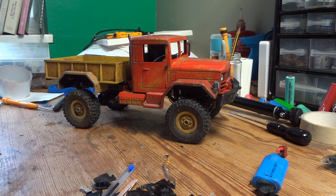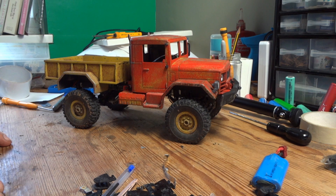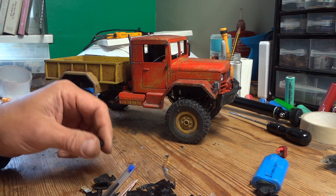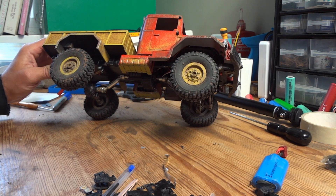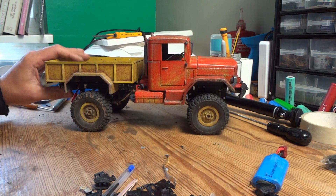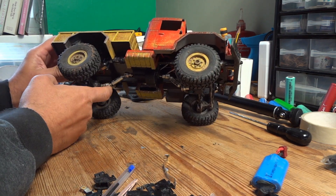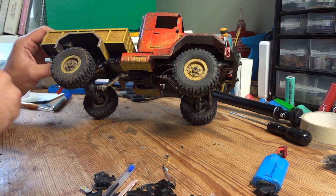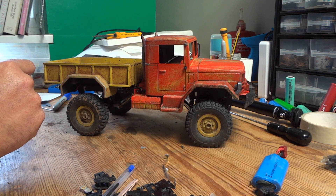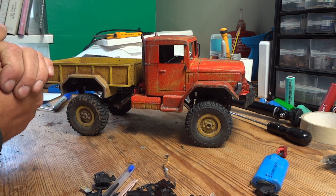As you can see there's a considerable amount of lift, and there's a massive amount of axle articulation. However, these springs feel very stiff, so whether you'll get any benefit from that added articulation is another matter. Despite my initial reservations, the kit has gone together okay in a timely fashion — I wasn't expecting it to go together half as well as it did, so whoever 3D printed them did a reasonable job. The only other reservation is the more extreme angle on the drive shaft. Anyway, let's take it outside and try it.